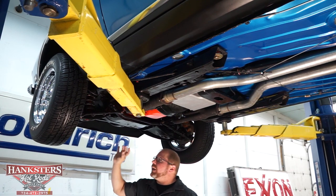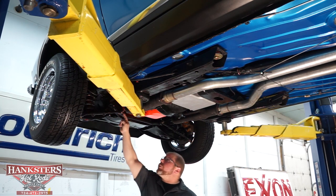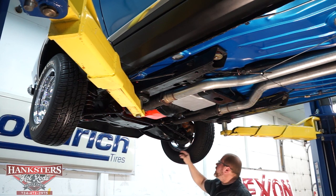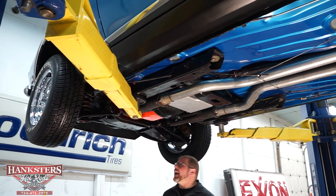As far as the steering, all your stock steering components — your tie rods, ball joints on both ends of both tie rods — are all in great shape. You've got the little rubber dust boots that are all intact; none of them are split. That's going to keep the grease in and keep the dirt out.